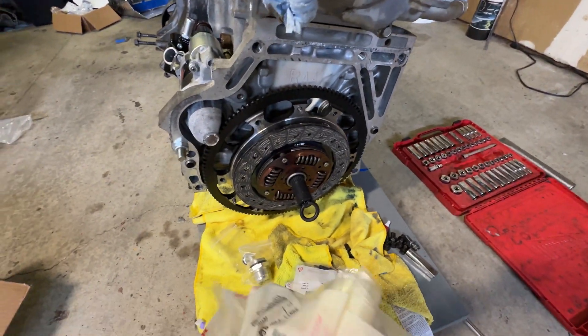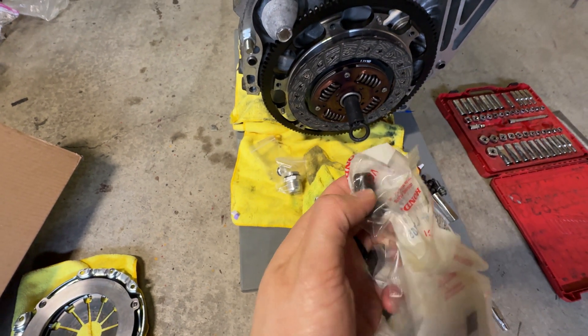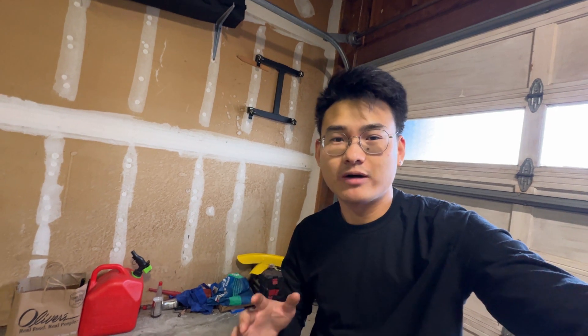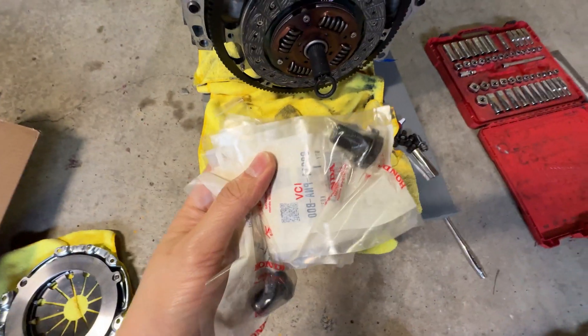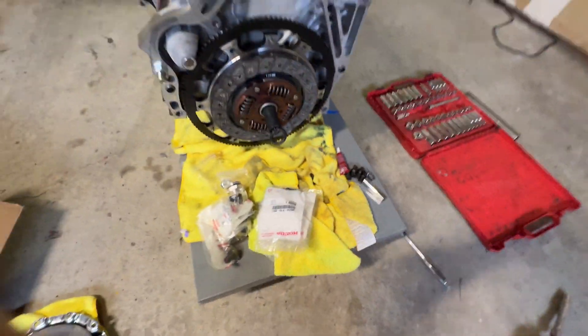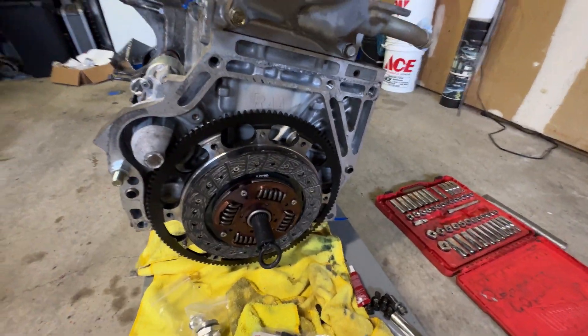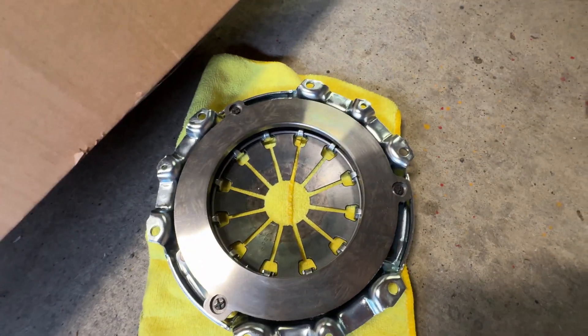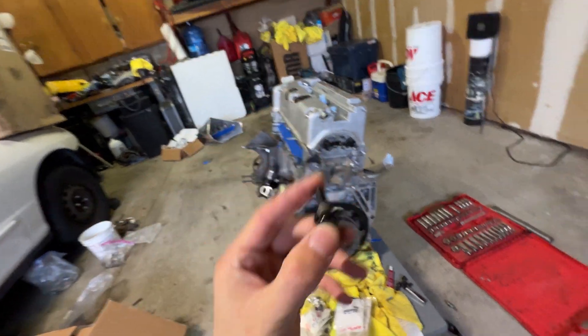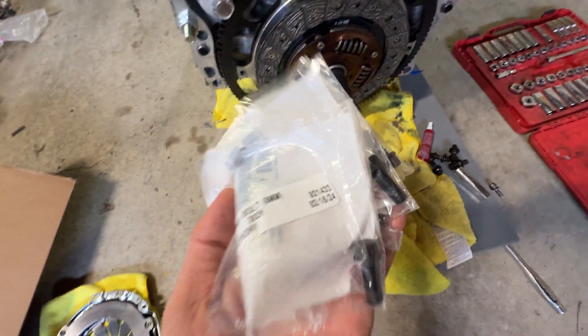So we don't want that happening. We're going to take them out and compare them to the OEM flywheel bolt length to see if it's actually true. I did a little bit of online research and found on a lot of forums that this is a genuine problem when building K series — they recommend using OEM bolts with a dab of Loctite blue or red. So we took the pressure plate off already, we're going to throw away the old ARP bolts and use all OEM stuff with a little Loctite.